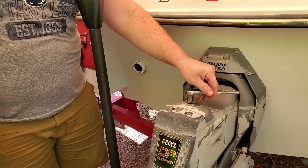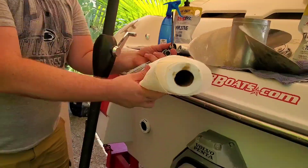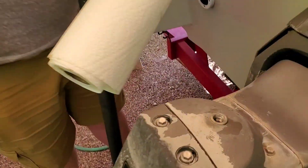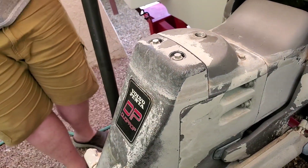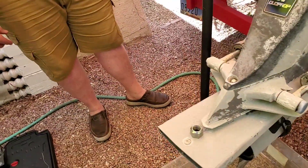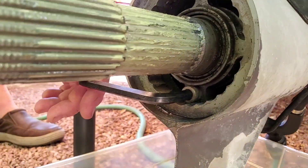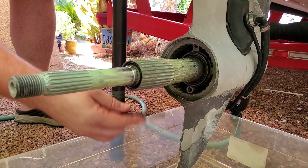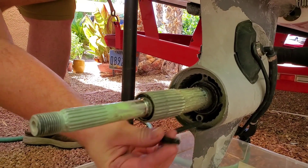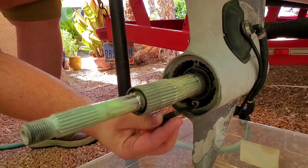Time to drain her down. Alex is going to go ahead and pop our dipstick up top — take that off and set it up top. This is very easy. It's a 14 millimeter to get into that, and that's where the gear lube goes — down into these gears and into the prop shaft. The Allen key down here is about an 8 millimeter. We tapped her very lightly with the penetrating oil so she came off nice, and then we finger-loosen her and yank straight out. I think we're going to be dropping about two and a half quarts.